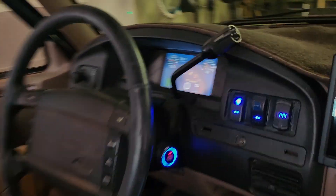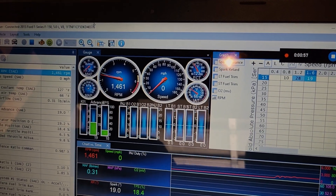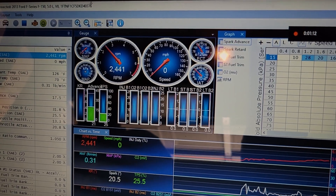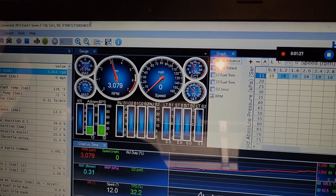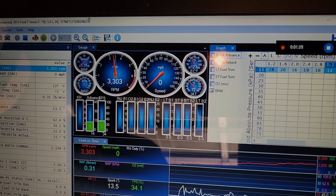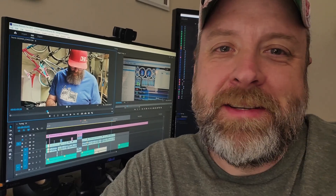We're going to do our first pulls — 1500 RPM for 10 seconds, then 2500 for 10 seconds, then 3500 for 10 seconds. There are lots of pops and bangs. That sounded gnarly — I don't know if it sounded good. We're going to download that information and send it over to Pat at Pat's Tuning and Performance, because it sounded like crap.